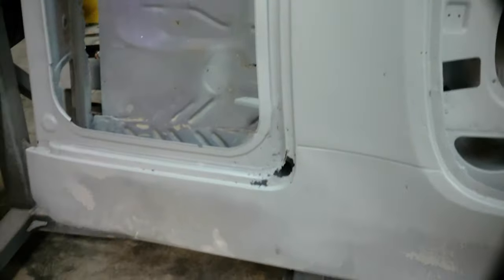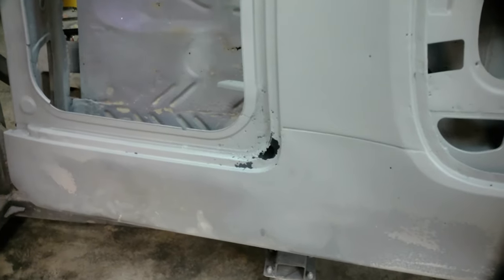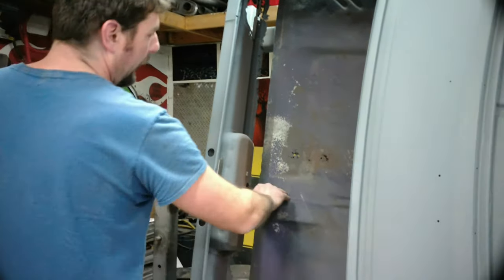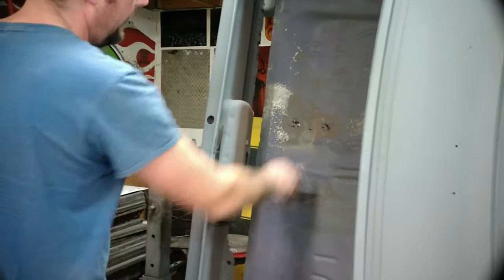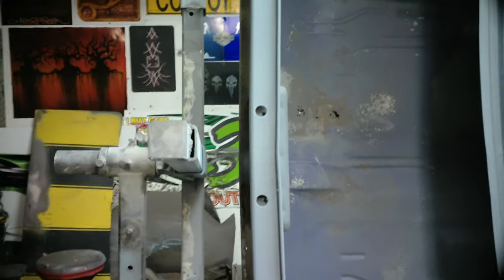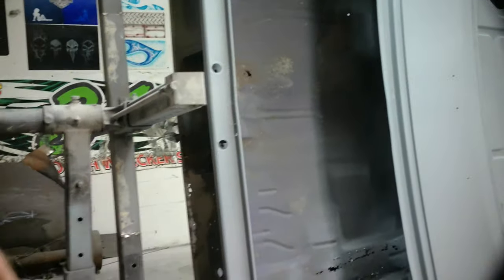We're putting full quarters on the back. You can see the channels in there are ate up. These were quarters that were installed on top of other quarters, so I'm assuming when we pull the quarters off, it's just going to get worse. The trunk wasn't sandblasted — we knew while sandblasting was happening that we weren't going to do the trunk. It's a two-piece trunk someone put in there, it's rusted and kind of folded up in the center, so that's another thing we're going to install.